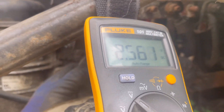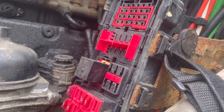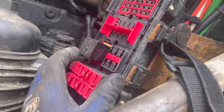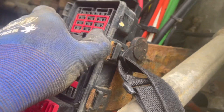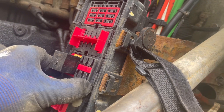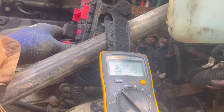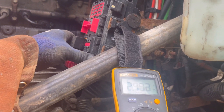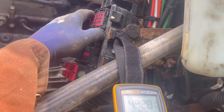I had nice bright lights with a test light earlier which indicates good voltage, but there might be an issue here preventing circuit conductivity. I'm going to need to get this thing out. I'm in the process of taking this fuse box out — the numbers are jumping all over already so I think we're in the right area.